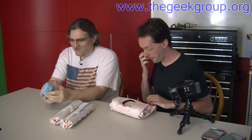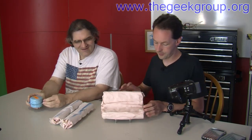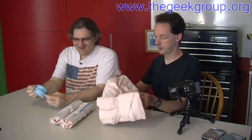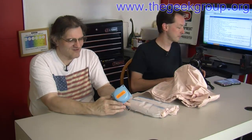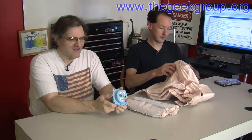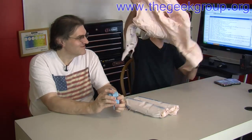This is loaded with a chemical that, when ignited, generates a whole lot of gas very quickly. Well, gunpowder does that. This is — sodium azide, I think? I honestly don't know what they use. Anyhow, this is all crimped and sealed, and there's a row of holes around the outside. There's a couple of initiation points. This is a two-stage airbag, so you get two different inflation levels.